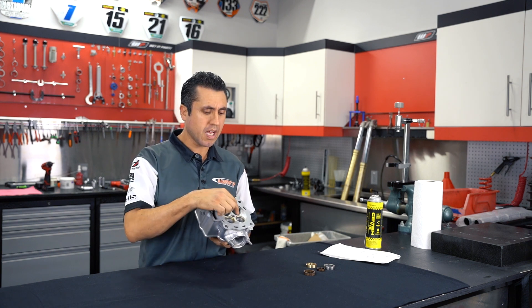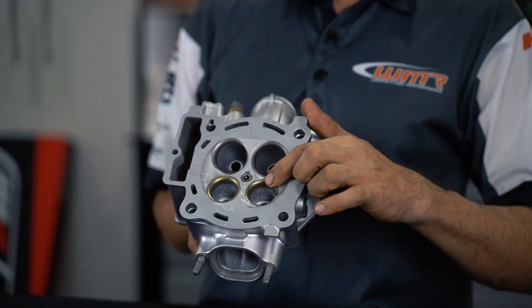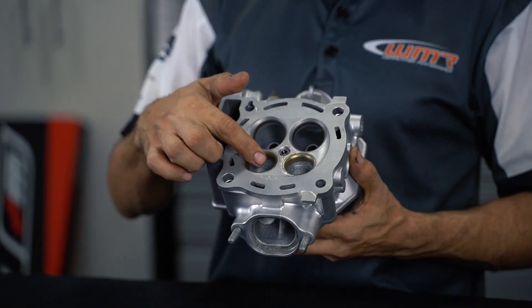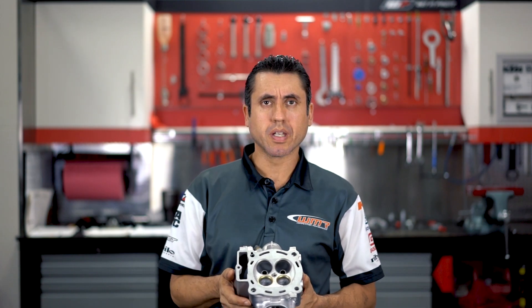This is a great example of what could happen and how a valve seat gets damaged. In this case, a valve guide fell down into the combustion chamber, and some pieces and chips started floating around, denting and damaging the valve seat. We have to replace it.